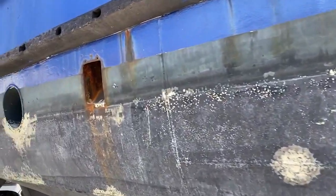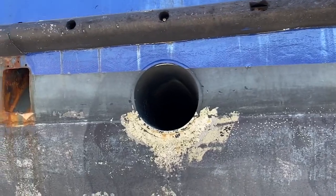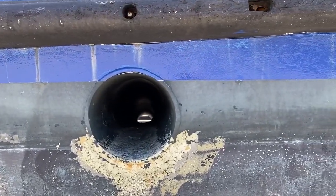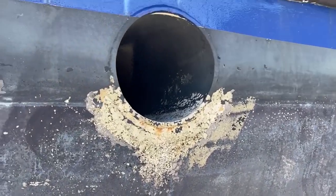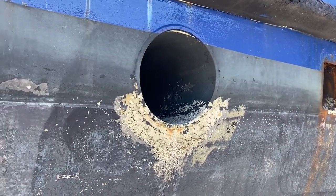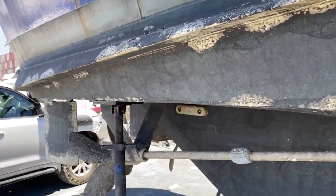So for these scuppers — a couple of scuppers — and that's the exhaust: that large round pipe there. You might be able to see straight through it; it goes through both sides. Both exhaust outlets pump into that central exhaust chamber and one goes out each side. So if the boat's pitching and rolling, there's always one large port where gases can escape and exit to the side.